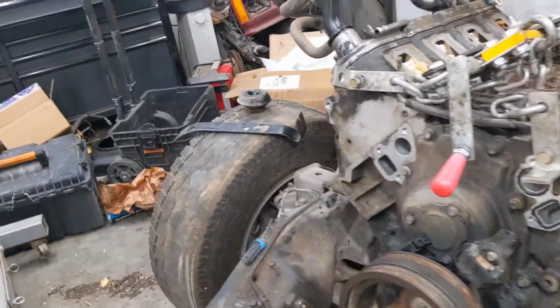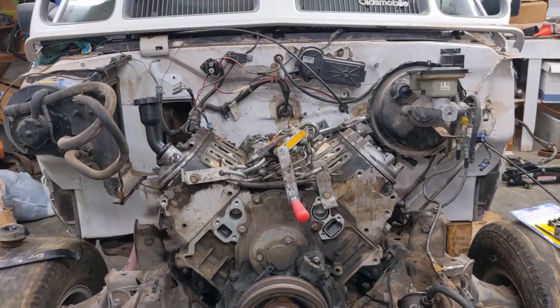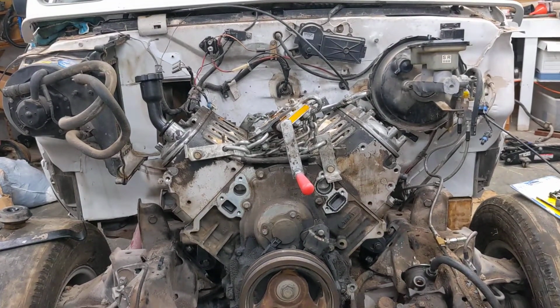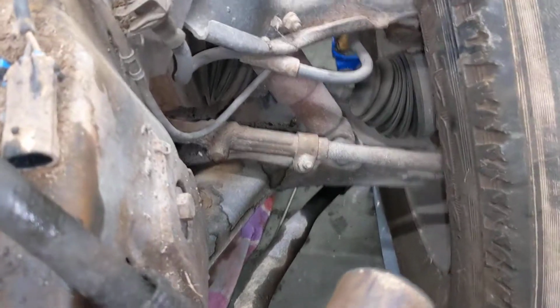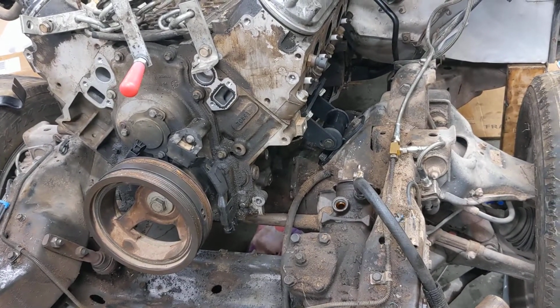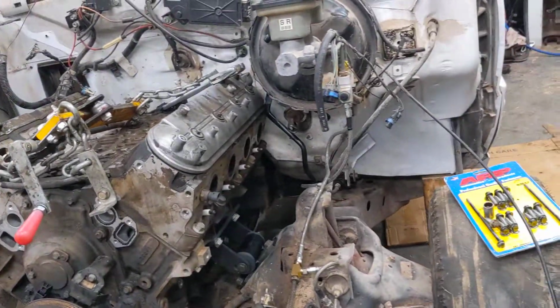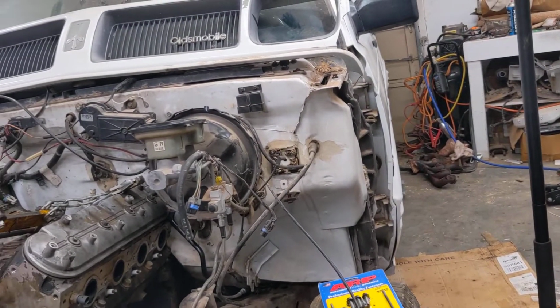It's the video. Hopefully this video isn't too long, but hopefully you guys will keep seeing posts on my journey, so that'll be good. I am going to lift it a couple of inches just by using torsion keys, which it already actually has. If you notice, even with the whole weight, the CV axle is kind of a little bit extreme, so I may actually drop the diff. eBay sells these kits to drop the diff slightly when you're lifted, but we'll see. I still need to add the weight.